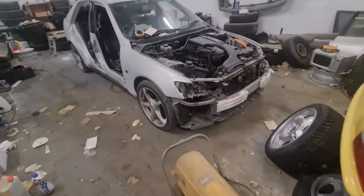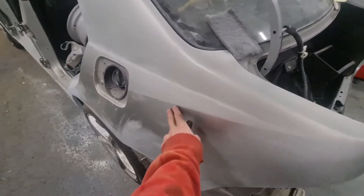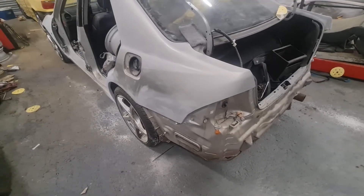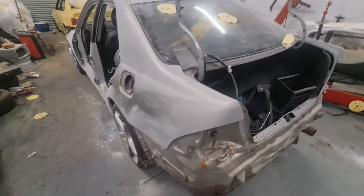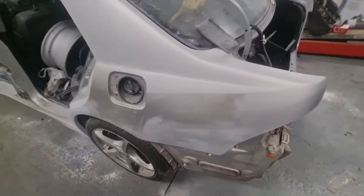Back to the Lexus. I'm going to get stuck in and fix the dent, prime it, put the infrared lamp on it, and then whilst it's curing I'll get the last bits of the car all keyed up. Then we'll flat the primer down and get it masked up ready for paint.